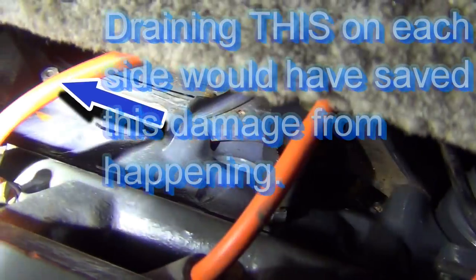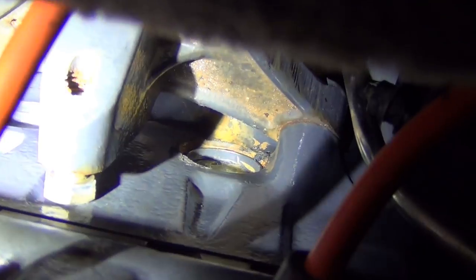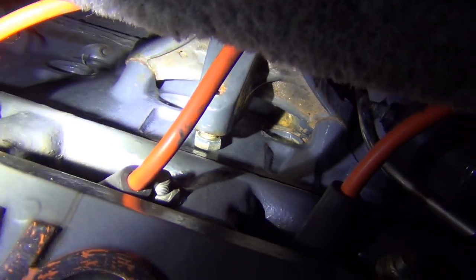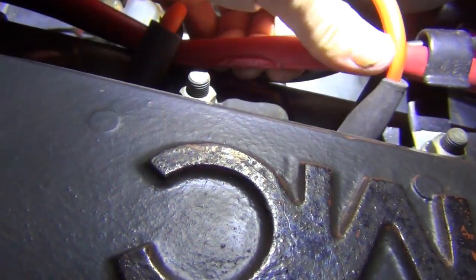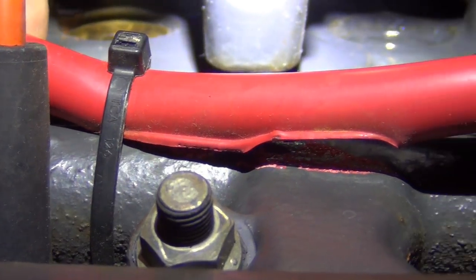Would you like to see the other side? The other side is even tougher because this rail is in the way. It's the same — I had to do one on this side too, and I had to reuse the original one. See, those are the freeze plugs over here. I'm thinking, why couldn't it have been that one on the end where there's tons of room? But using that gap with a pry bar actually worked out to be a good thing. I got it nice and flush and perfect — just squeezed in that tiny little space. As you look down here, check that out — it overheated, they say. And you've got all these wires that are melted into the exhaust here. Check out this starter wire — it was cooked on there too. How did this thing not catch on fire and burn to the ground? You can see it was zip tied — look at the plastic that transferred. That should have made a significant stink.